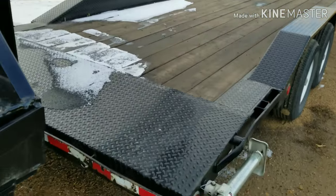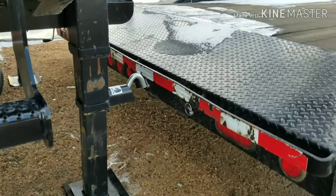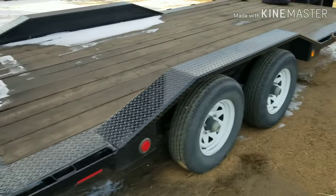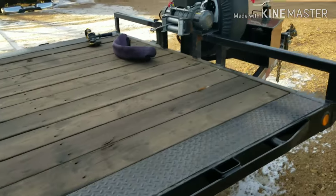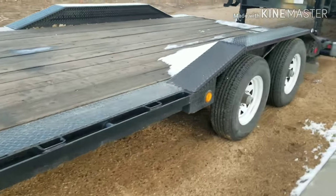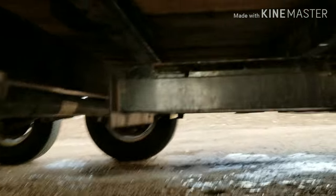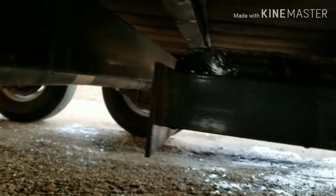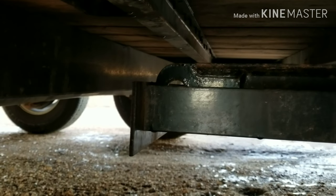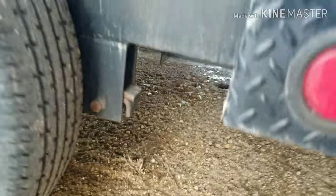The ramps on this one are right here. Sorry I can't get any of them out because the trailer's in the way, but they latch on right here — just a couple little hooks and you're on your way. One thing I'll say about them though is when you're bouncing down the road, the hooks for the ramps bounce over the top and they get stuck. You try to pull them out and they're hooked on the end. So you can turn the ramps around, turn them upside down, or what I'm going to do is weld a plate up there so that it can't bounce forward. Problem solved.